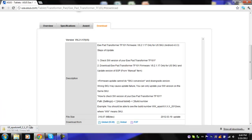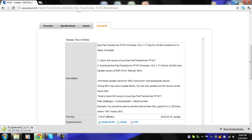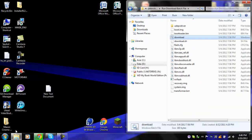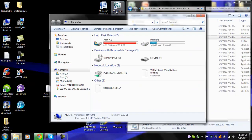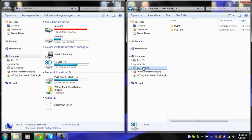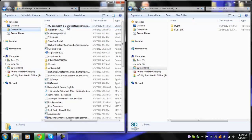I'm going to be right back when this is done downloading so that I can flash it to my tablet. I'm also going to go through the setup process on my tablet. So me being the dummy that I am, I forgot I already have this file on my Transformer. So I'm actually going to walk you through how to do it right now. First of all, you're going to have to open up two of these windows. On one side you're actually going to want to have your memory card — you cannot go through your Transformer. This isn't the right memory card, but let's just pretend it is. So as you can see: SD card, H drive — this will be the micro SD. You need that little SD card size adapter. And over here you're going to go to the download of the 9.2.1.17 file.